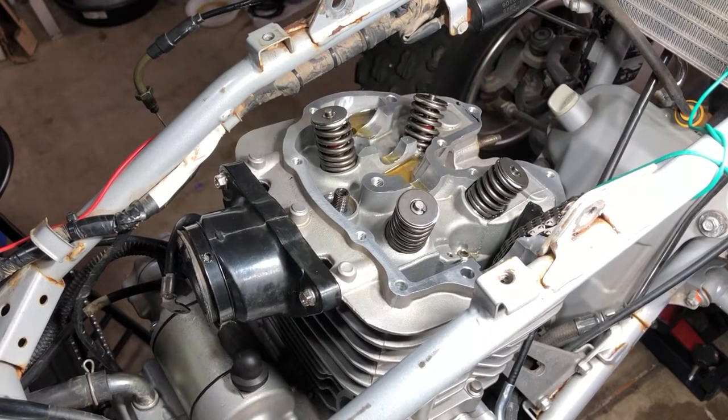All right, now the bolts are off, the head bolts are off. We should be able to just lift this dog right on off of here. And let's get the chain out of the way and unhooked and get this baby up on off of here and one step closer. We only got one more thing we need to remove, and then we can replace the base gasket and put this... Oh, we can't put it back together yet, though. We got one more thing we're going to do. As long as we are apart, we're going to replace the timing chain. So we'll get on to the next steps of that. But let's get this cylinder head up and off there.